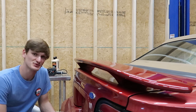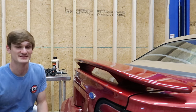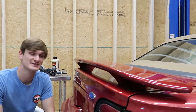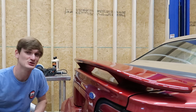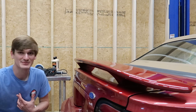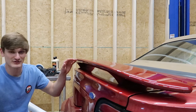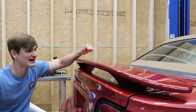And I'm also able to remove 2000 grit sanding scratches without having to do a follow-up step. There's products that advertise that they'll get out 1500 grit sanding scratches, and I've used them all day long and tried different ways to use them and different methods, and they almost never work. So in my experience, unless you're using a rotary, 2000 is about as rough as you want to go with being able to polish it out relatively easily afterwards.